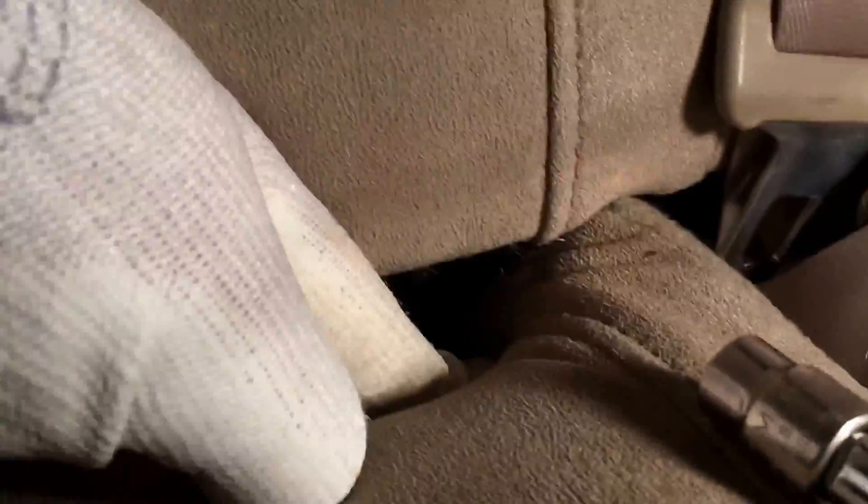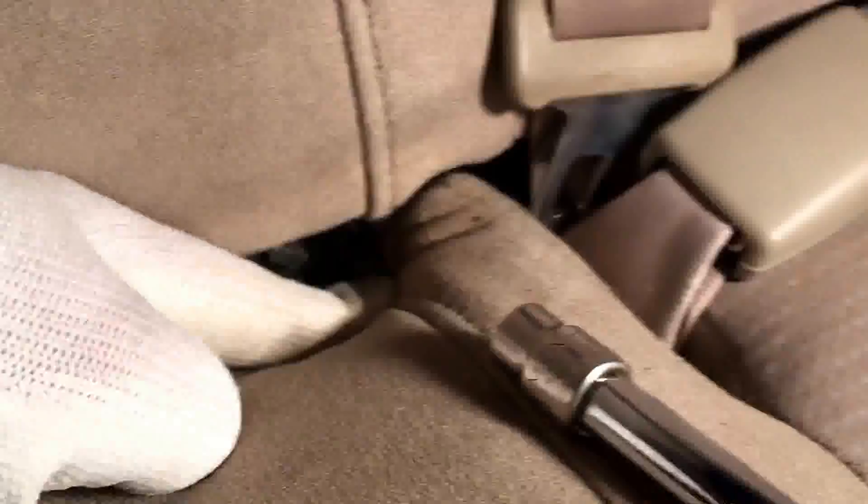You are ready to take out the seat for the hybrid battery replacement — it's right behind this rear panel as you can see. The seat itself pops up fairly easily. First of all, move your front seats all the way forward so you have lots of room to maneuver. You're gonna pop up the back seat by pulling up right here, and then on the driver's side you're gonna see a little hook and a little bolt right in there, next to a middle brace. Right next to that middle brace you're gonna find a 10-millimeter bolt with a hook which actually holds the seat down — you can see it right there. Get a 10-millimeter socket with an extension and take that out.